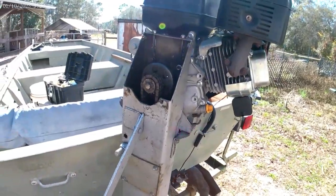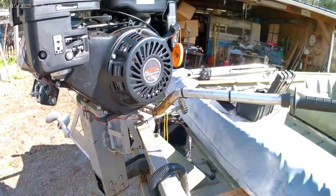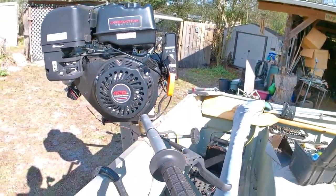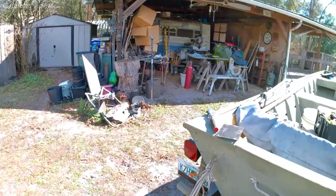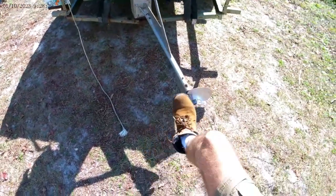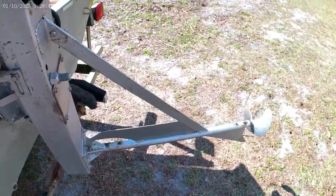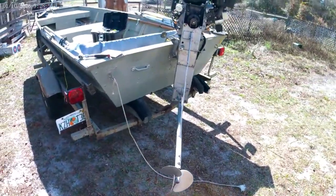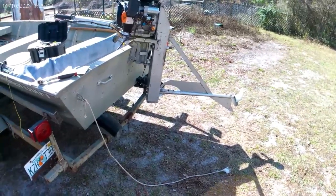NitroChain was easy to work with — it was like $120 for about 10 feet of chain. I ordered some extra keys for it as well. For the throttle control, I tried a twist throttle but it was uncomfortable, so I just use a basic throttle ordered off Amazon — works great. The boat has plenty of turn in it; it'll do a donut easily. I've run it through six inches of water with two people in light gear — it did it fine.